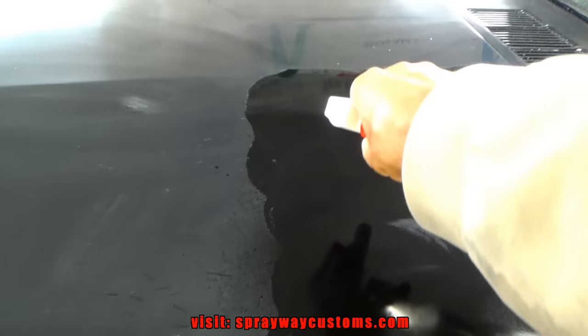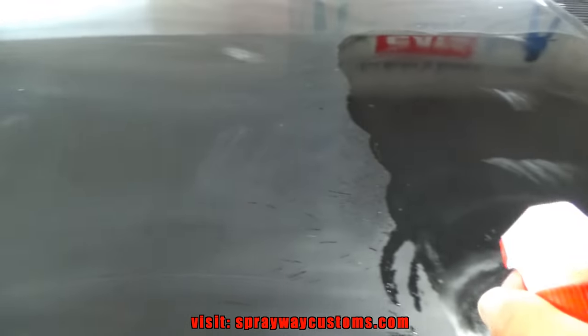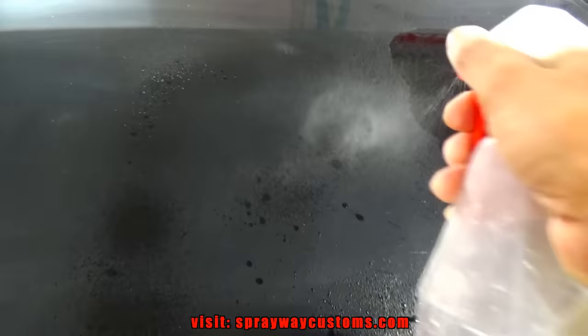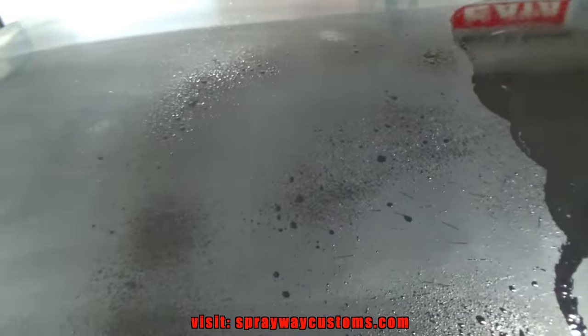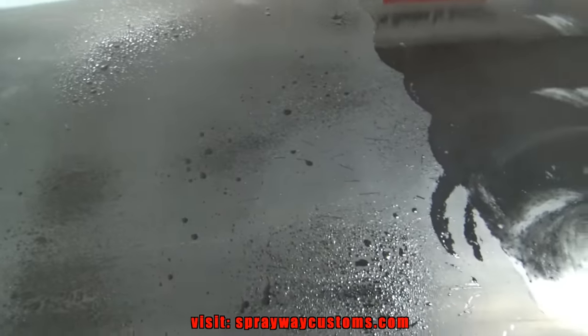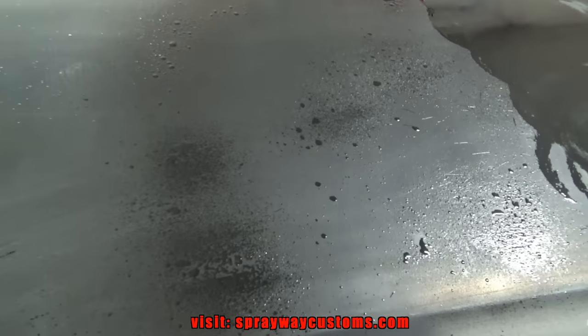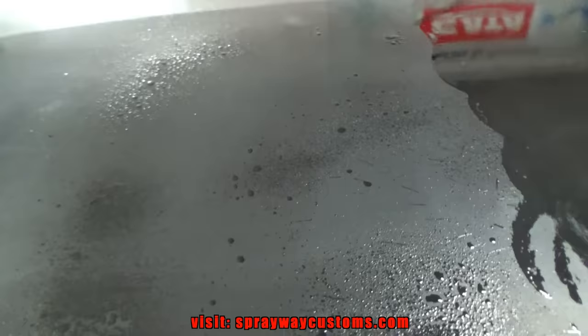I started with the 3000. I already did this area here. You don't wanna work in a big section; about 2 foot by 2 foot should be fine. But you just want to mist it on like you did the 2000. And you're going to start seeing the shine coming back with this 3000, because it's kind of dull now. But when you hit it with the 3000, it'll start bringing that shine back.